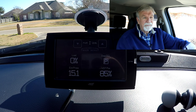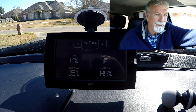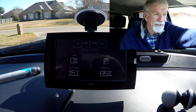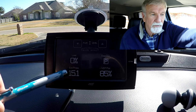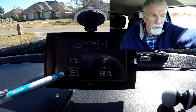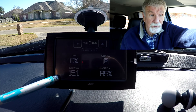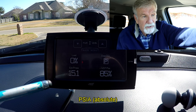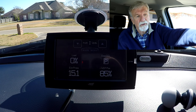Let's take a look at this monitor here — it's terrible when the sun's shining on it, and it is right now. We've got engine load up here. We've got exhaust pressure right here, which is the good one we're going to want to watch — that's your exhaust manifold pressure. There's a tap right into the manifold with a pressure sensor. It's a tube that comes off of it, reads exhaust manifold pressure, and that's part of the EGR system. Load is a little bit insignificant, but you'll see a small load change when we go from park to drive.